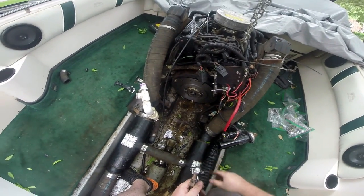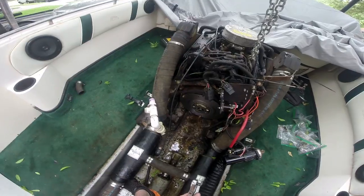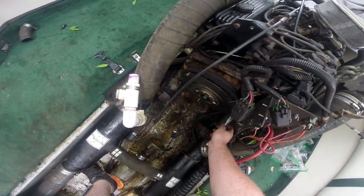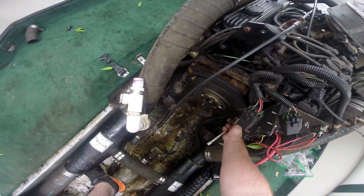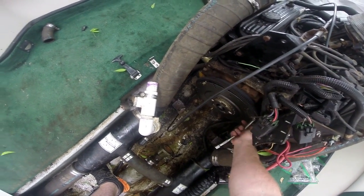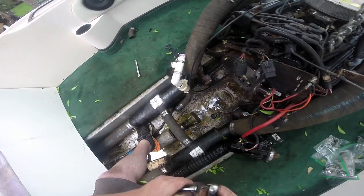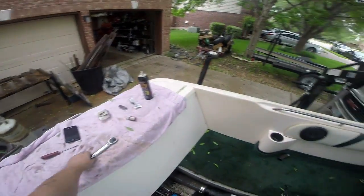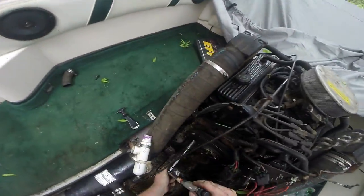So there's our dampener plate installed. Now, we put a little Loctite on all of our grade 8 bolts. Generally, I frown upon using these lock nuts on something like this, but since the original application used it, it may be needed as a spacer for the bolt head, so we're going to stick with it. And these bolts are 9/16, and we're going to go ahead and torque them to the same 60 foot-pounds.